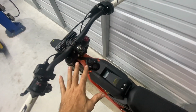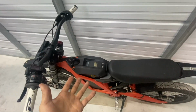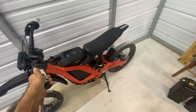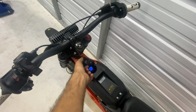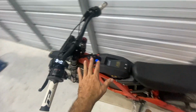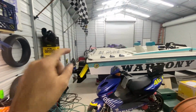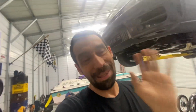There's a setup procedure. I already went through it just to get it done, but you just download the Torp app and use the setup wizard. It's really simple. It calibrates the motor, the throttle, everything. And we set the battery for 72 volts. This thing comes on. Look at that, ready to go. So let's go ahead and charge the battery now. The rain is falling, so we're not gonna be able to ride today, sadly, but we've got the dyno. So maybe we'll throw it on the dyno in the next video. But that was the install.